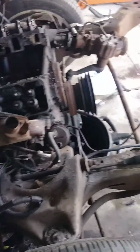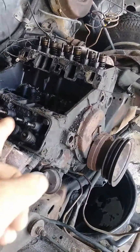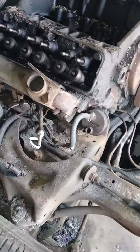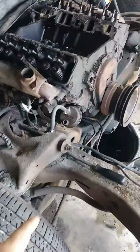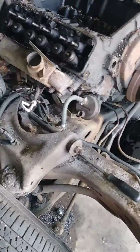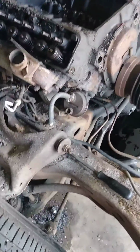Alright. Oh, this is what I got done to the car yesterday. Yes, there's floor dry over this damn motor because it was on the intake manifold. But intake manifold's off, lifters are off, whole motor's out, valve cover, everything else. I pretty much got it all disconnected, torn out. Today's goal is to get the exhaust manifolds off, well, dangling off to the side, because they're still going to be there, but get them unbolted and all that, and get the heads off.